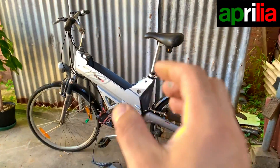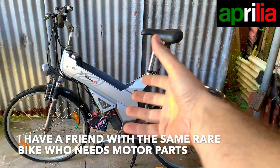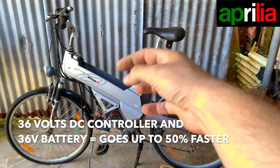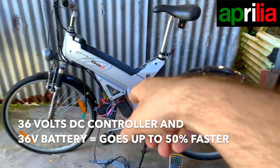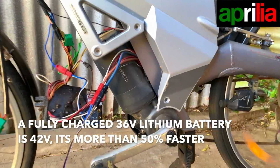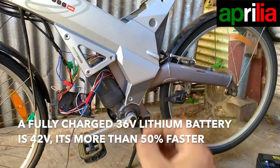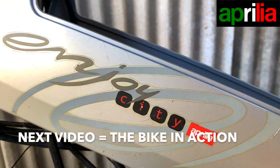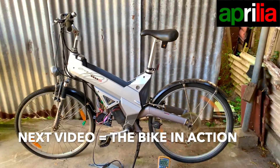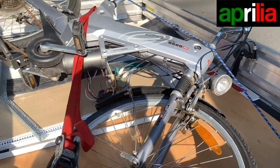It's not very sexy, but back in the day the swing was like wow. A friend is coming here — he's got the same bike but did it all in black, and revamped it with a 36-volt controller. He's actually coming to get this motor and transplant it to his bike. Then we'll make another video actually running the bike at 36 volts. It's going to sound a little bit more like that, but 50% higher pitch because it will be 36 volts. So much more power — it's going to feel like a real bike. Wait for the next video, we're going to show this thing in action.